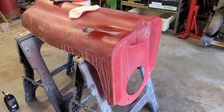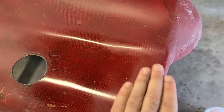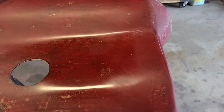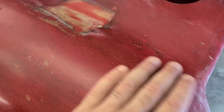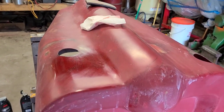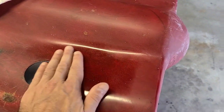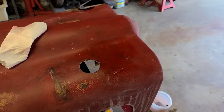As you can see I started the wet sanding process. That is 600 grit, and then I quickly hit it with 2000 afterwards and polished it. I think what you see here is exactly what the hood is going to look like when it is all polished up. I am fighting a bunch of sand scratches from the heavy duty sandpaper I needed to use to get the old paint off. But when you stand back here, you can definitely see what it is going to look like. You can also notice how wavy the fiberglass is — that is basically what happens with 60 year old fiberglass that sits out in the sun for decades.